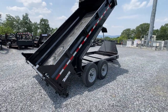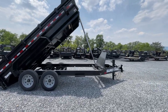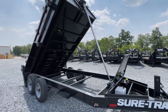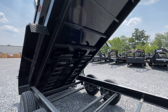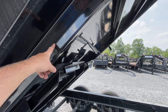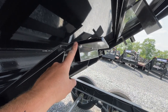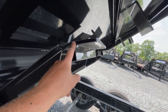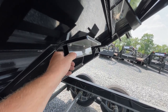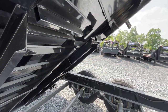Two-foot sides are standard on this. Some manufacturers are doing a 20-inch side — I've even seen some do 18 — but 20 is pretty normal. A couple other details: the bed frame is a little heavier, five-inch heavy wall instead of four. One thing Short Track does nicely: on the end of the ramps this is half-inch plate. We've seen manufacturers use quarter-inch and over time it's going to bend. That's your retainer — it's going to hook on the back of that hook bar. Ramps on these are four-inch, not three-inch.